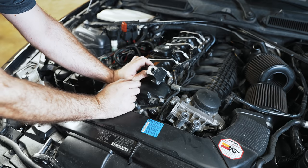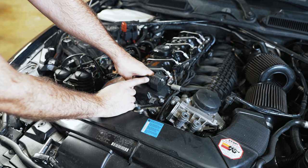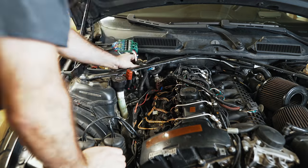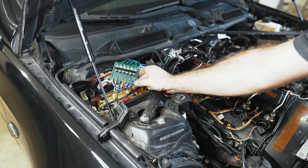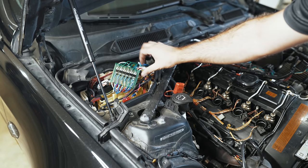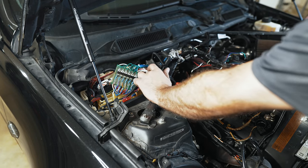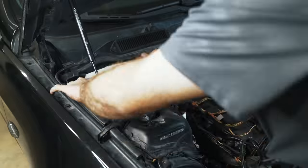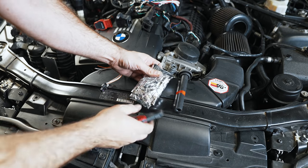There are only three pins on these coils. If you have the older MSD80 and want to run B58 coils, maybe don't run the higher dwell option in your tune or in MHD - you'll still get a benefit but you won't be pushing more spark energy than factory. I just ran a conversion board to convert the signal to trigger the Audi coils, but that's where the latency comes in. This was just a little experiment cobbled together to show what could be possible. In 2021, if you want more power, people are running B58 coils.